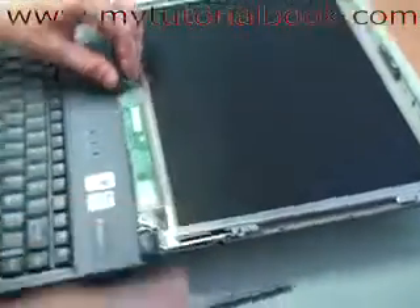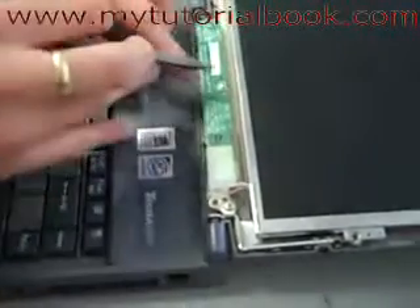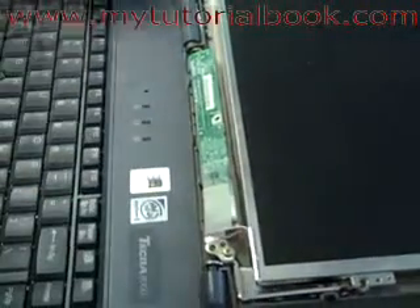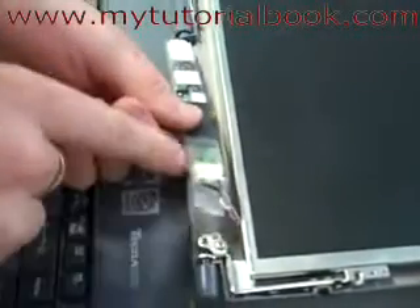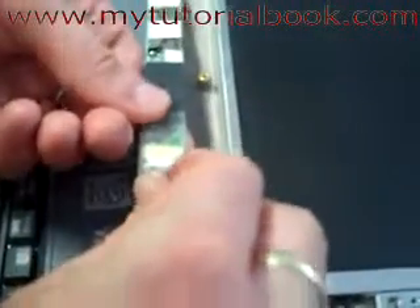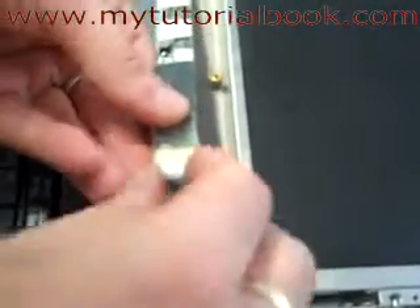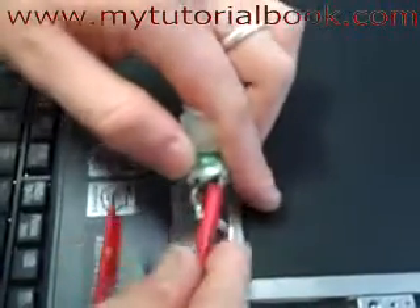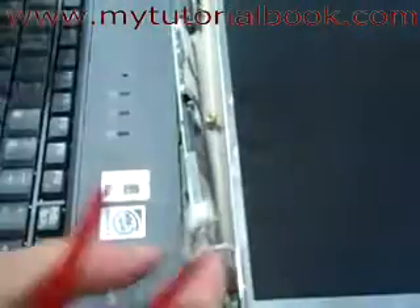Come down here now — your laptop might be a little bit different. There's this chip here, and right in the middle there's one screw, so take out that one screw. Be very gentle with this bit — they're a bit delicate. Then fold it over and you'll see this little tab here — it's just an ordinary clip. Jiggle that out with the screwdriver. There we go — take that bit off.